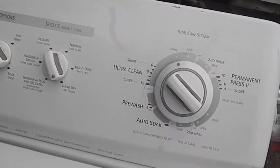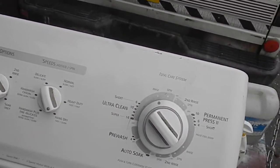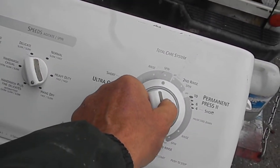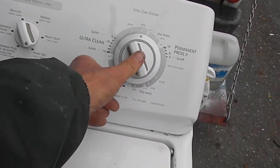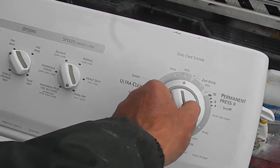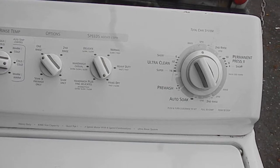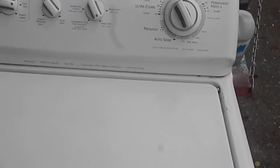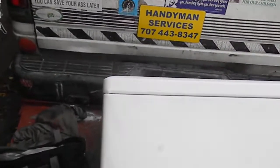This one has a good spin, but if we put it on spin and turn it on, we hear a sort of clunk when it stops. That clunk could eventually erode the drive coupler — it's a noticeable clunk.